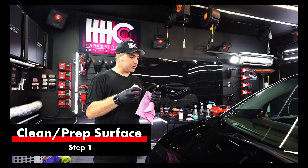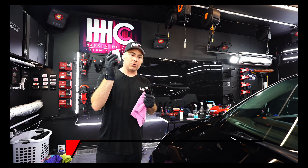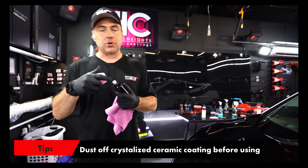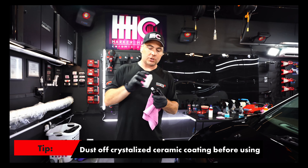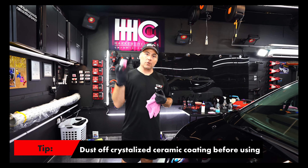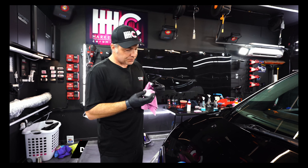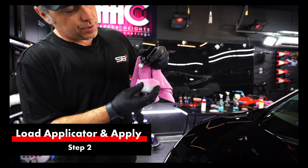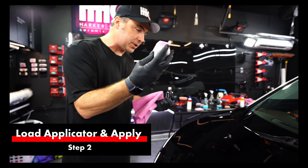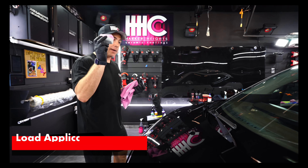Just like other coatings — like I showed you with Vortex and other things — if it's not a new bottle, I use one side of the coating applicator just to dust off the top. This is a pretty new bottle so it doesn't have the crystallized stuff formed, but eventually that builds up. I use this side to clean that off from the last application, then flip it over and use the other side so the crystals don't scratch the paint. You can put maybe 10 to 12 drops on, and I'm going to show you it'll coat this whole hood with just that and this applicator.